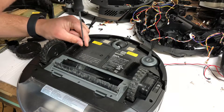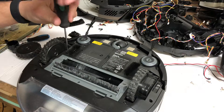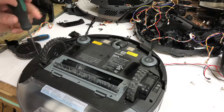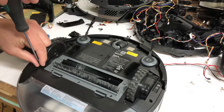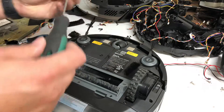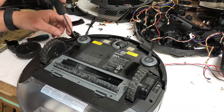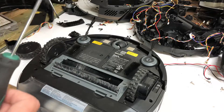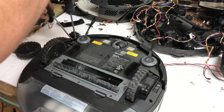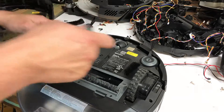Like we said before in other videos, there are five T10 screws. I suggest if you're going to do repairs, just pick up a Torx bit kit — long shaft, skinny head. You don't want one that has adapters; that won't fit in the holes all the way. I'll leave a link in the description below if you need certain tools. If you're just trying to test this, you can put one or two screws in and they'll hold it pretty well. Sometimes your magnetic tip won't hold — take a flat head and put it on the side with the working magnetic tip and you'll be able to get down in there, or just take the bumper off.